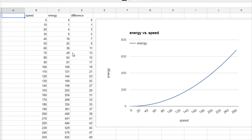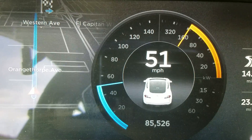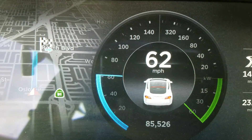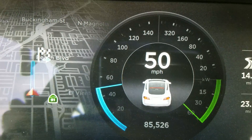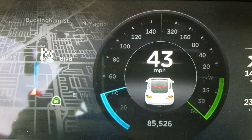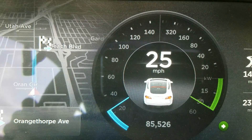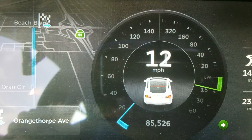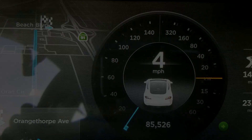And that's exactly what Tesla does, and I want to show you that in the next video. Here I'm accelerating to a little over 60 miles per hour and then letting go to get maximum regenerative braking. You can see it starts at 60 kilowatts, and as the speed goes down the car automatically adjusts the regenerative braking power lower and lower. As a result, it feels consistent all the way down to about 4 miles per hour, where the regenerative braking just fades out.